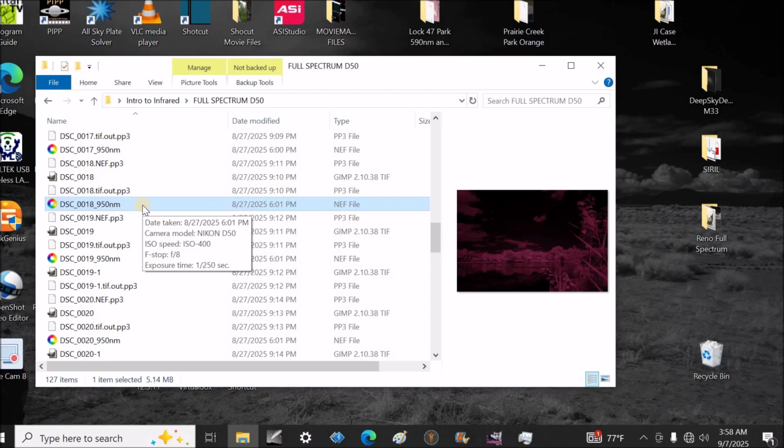Apparently there's actually another sensor in the camera, somewhere up in the viewfinder area. And the idea is when you're looking through the lens and you measure your exposure and measure your autofocus, it uses that different sensor. And it has its own UV infrared blocking filter as well. I did not remove that filter. I'm not sure how to access it or if I even can. But that affects your camera since the lens is covered with the filter.